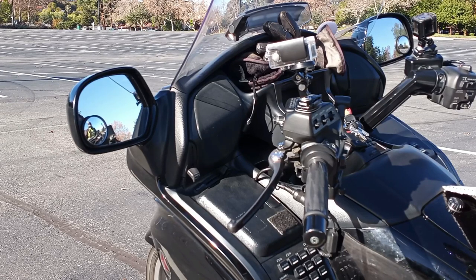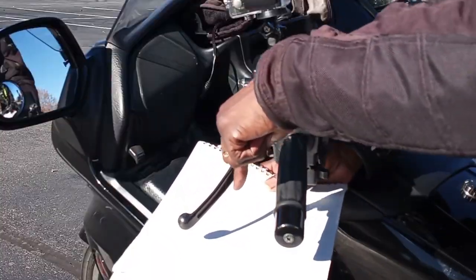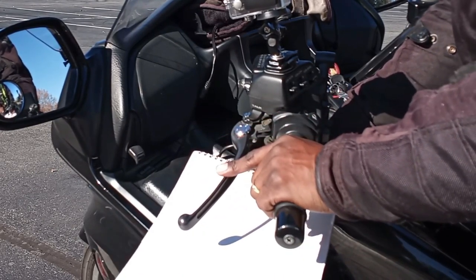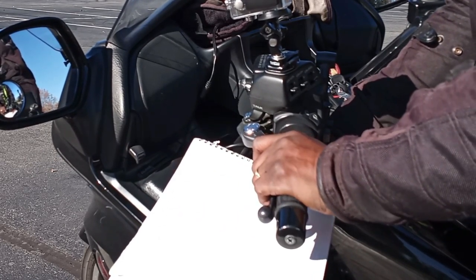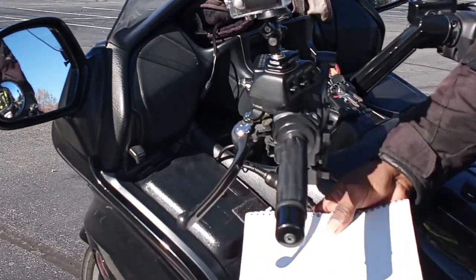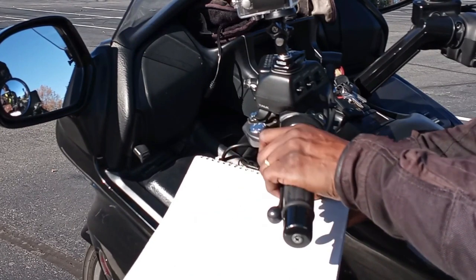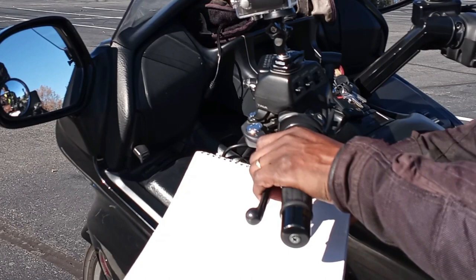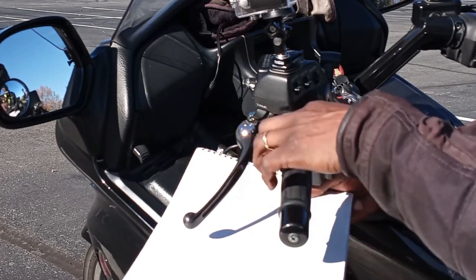So what is the friction zone and where is it? The friction zone is this area right here. In order to be in the friction zone, I cannot have the clutch all the way out — because then I'm giving my rear wheel 100% power. If I pull the clutch all the way in, that's zero percent power. So the friction zone is right in between. And let it be known: the friction zone is different on each and every bike. For me, as I'm riding, this is where I start my friction zone.